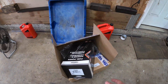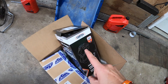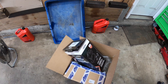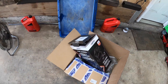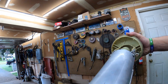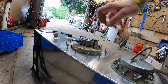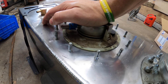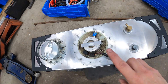I did try a TJ pump — this is a Carter from Rock Auto — but it's the same height as a factory XJ pump, so I'd be kind of recreating the same issue. This thing would be about a quarter inch off the bottom of the tank and still flop around. Now if you look, the pump is sitting not quite flush, but once I put that retaining ring on, I want a little bit of pressure so the pump housing is on the bottom of the tank and not bouncing around. That's what killed me in the first place. I know this pump works, so we'll see what happens.